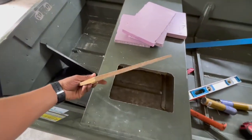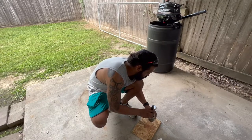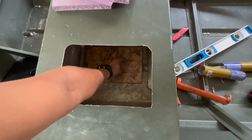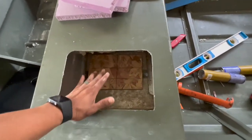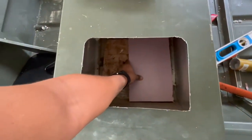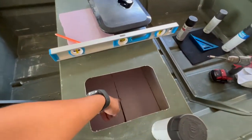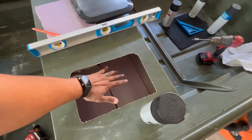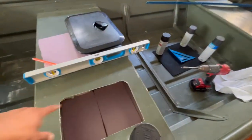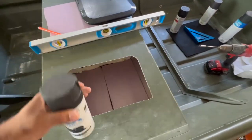Change of plans — I got a little half-inch piece of plywood that I treated with some waterproofing. I'm going to put it down. As you can see, I marked where not to put glue. I'm going to put glue right here so it raises up this piece, just giving it a little bit more resistance from water. We've got the plywood underneath that — with liquid nails down, it's on there pretty tight, not moving. But before I put that carpet in, I want to spray everything black so it kind of hides all the blemishes. I got some cheap spray paint — let's get to spraying.